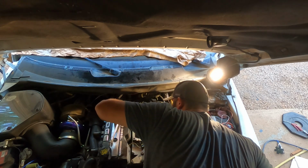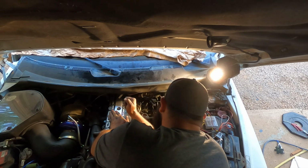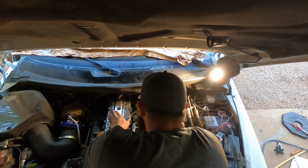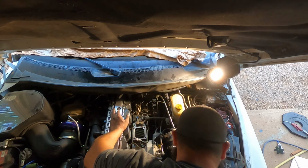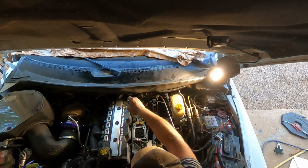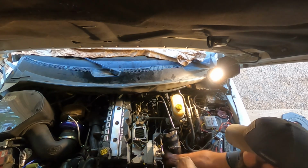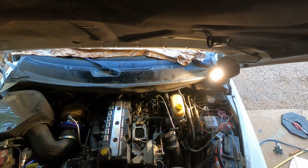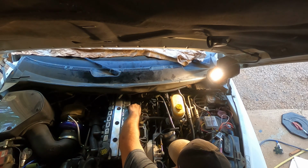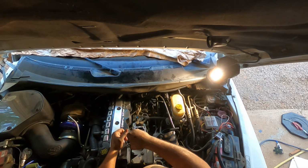Nothing leaking over there, except for my tappet cover. So here I'm just cracking injector number 3 line to see if I can start getting some fuel into the rail. Got fuel going to the pump. It's on its way. There she goes. All right, we got prime on cylinder 3. All right. So check prime on this one too. Should almost be there.